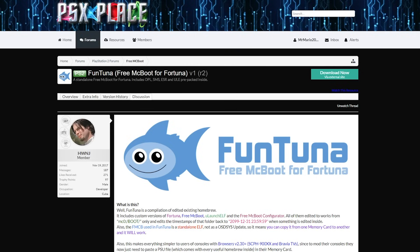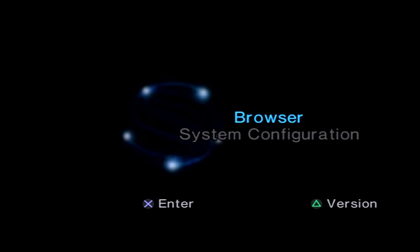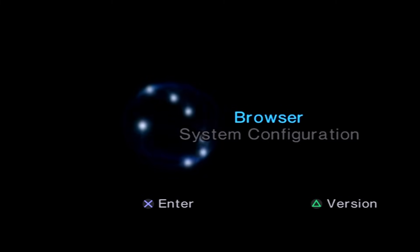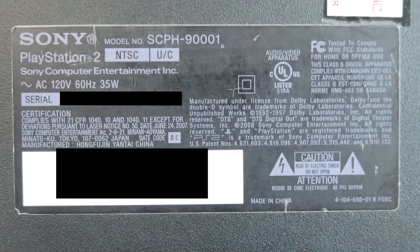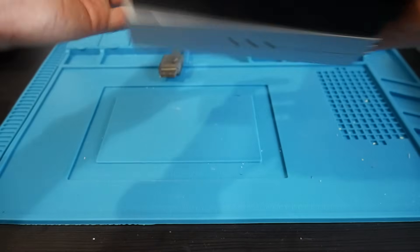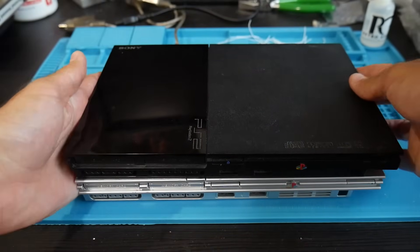Typically FreeMCBoot is recommended for the PlayStation 2, which is something you can install on your memory card. ForTuna is an alternative exploit you can use which works on all PlayStation 2 slim systems, including the later revision 90000 series slim systems where FreeMCBoot's exploit was patched out. That means all PS2 slims, including the patched ones, are vulnerable and can use ForTuna. Now, all PS2 slims using software only can use FreeMCBoot thanks to FunTuna, which makes it pretty fun.